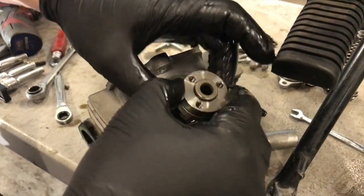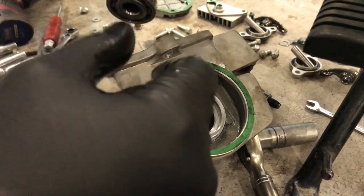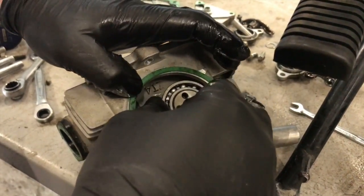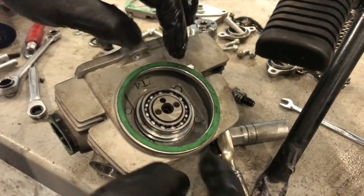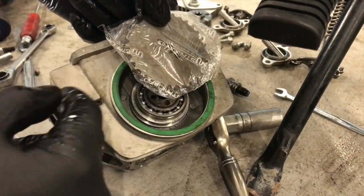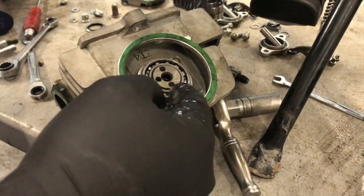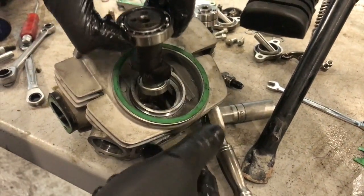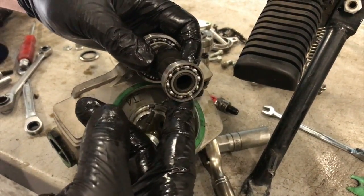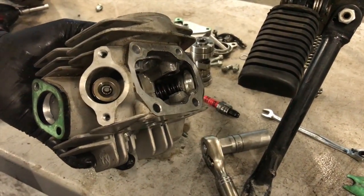We just dragged this cam out. So that's the cam we've taken out. You see how it fits inside that inner race? It sits inside this inner race here, while the Z40 goes in, with all the logo and stuff on it. It goes in there and sits in the outer race, hence why you've got to use their pulley. And theirs has got two bolt holes in it instead of three. When you're looking at this, they look completely different, but this cylinder head with a big valve head will take this style cam. So that's cool. But we are going to fit the valve springs because I'd rather have the valve springs and know that they were the ones that match the cam. So let's get it over to the bench and pull these valves out and then see how we get on with that.